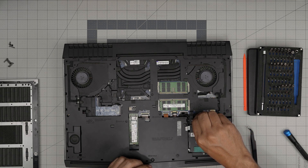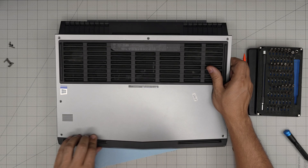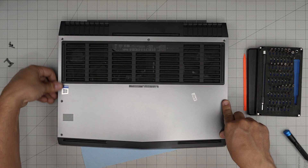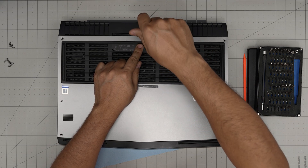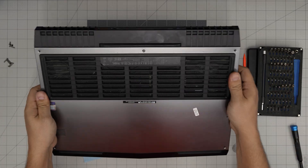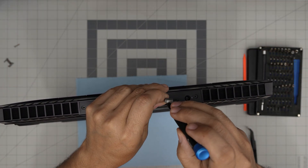Grab the battery connector and plug it in straight, pinching it all the way in. Grab the bottom cover, bring it down at a 45-degree angle with the front end first, scoop this side in, then put it down and squeeze the corners until you hear those nice big click sounds. Push on the sides to hear the clicks — don't push in the middle. Tighten the screws to pull the cover to itself. Then put the two tiny screws on the grill on top and the rest on the casing.